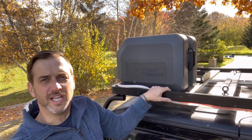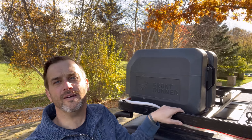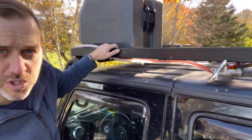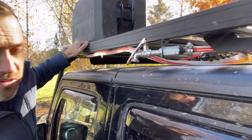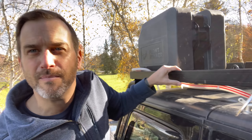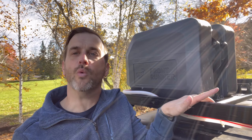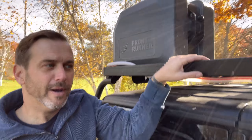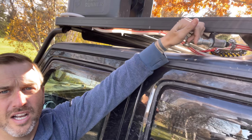Keep in mind the tank is mounted on the roof, so it's going to be gravity fed. We never had any problem with that, but just make sure you mount the spigot underneath the rack instead of on top. I tried it up top first, but the hose had to come back up and I couldn't get a good water flow when the pressure got low because the tank was getting empty. So you mount it underneath — it's got a nice little locking system.